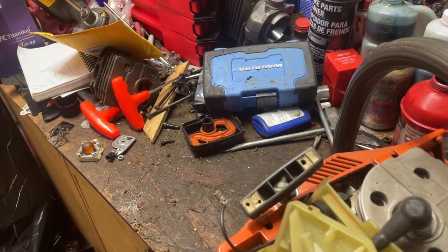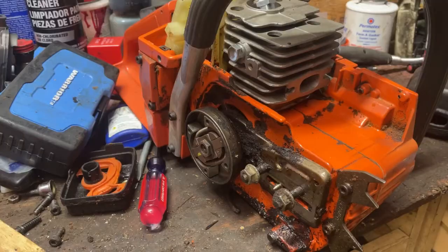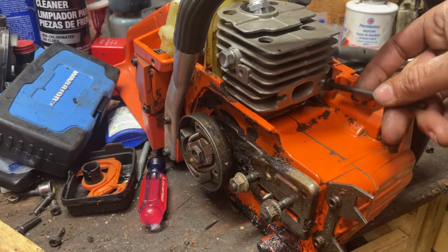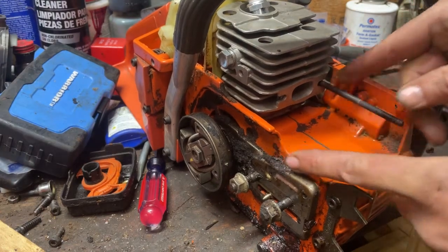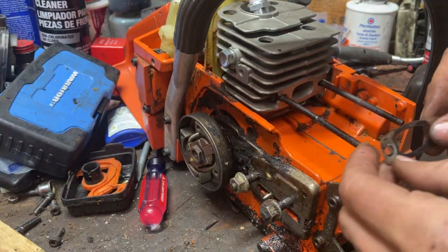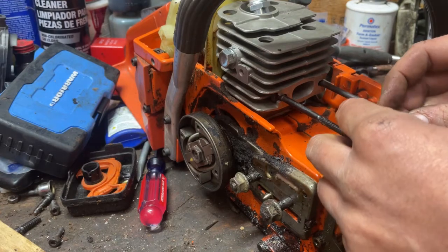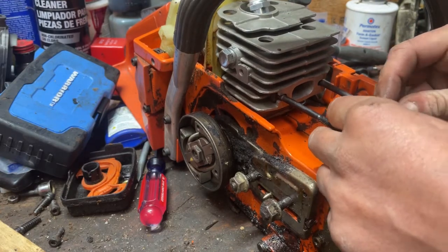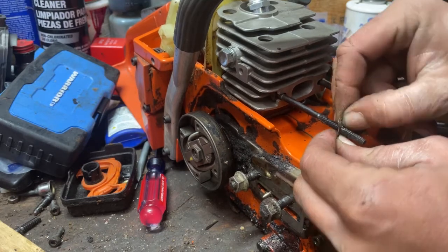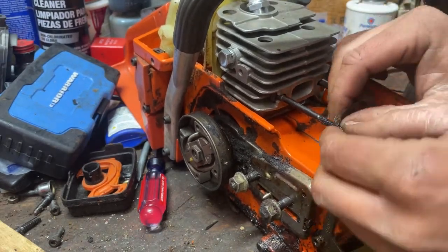We're going to get the air filter on and attempt to fire it. I haven't even looked in the carburetor yet. These mufflers go on a stud, kind of like the 029, 290, 039, and the 390 Stihl — they fit in a little notch. This isn't a standard cylinder either — it's a nikasil cylinder. I don't know if it makes any difference as far as how it actually functions. I've never checked an actual 51 or 50. The 50s have a 45mm piston where the 51s have a 46mm piston, which works real well with the 028 Super piston, them being the same size.